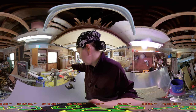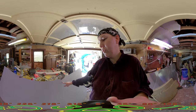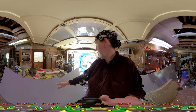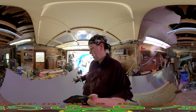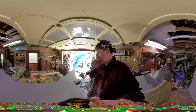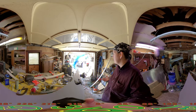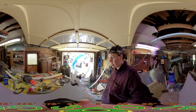And so what I'm going to do right now is pull this off there for one. Air mask. New air mask. Pre-drill here and here all the way through. Once I have the pre-drill, that's kind of my alignment. Annoying, isn't it? And then when I come back here, I got it stenciled out where all the lines are, and I'll measure it out and drop a bunch of drills in that, and then I'll stick it back up here, line it back up, and then drill it from this side and rivet it. I was going to try to do a reverse hand rivet nut in there and screw it in from the back side, but that's more work than I really want to do. And I don't really want to take it off once I'm done. All I have to do is just get everything done in the right order to get up there.